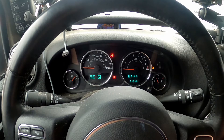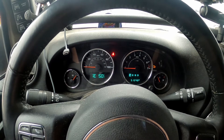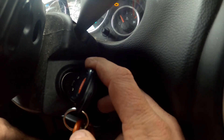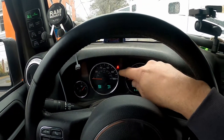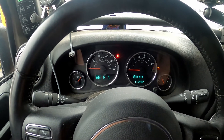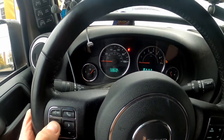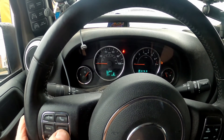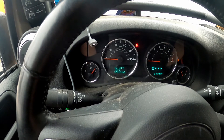So that was it — great, pretty simple. Again, I have the 2016 Jeep Wrangler Unlimited. Put your key into the second position, which is the run/on position — do not start the engine. When the dashboard lights up, press your accelerator three times within 10 seconds and then your light will disappear. So now I am reset. If I go into the menu and look for vehicle info, my oil life is now at 100% remaining. So it's all reset.